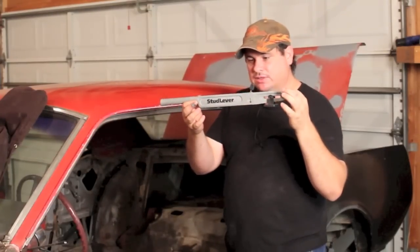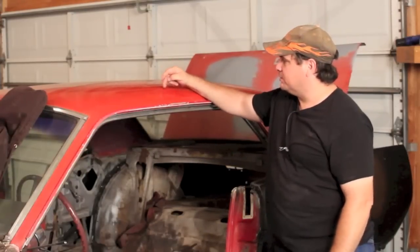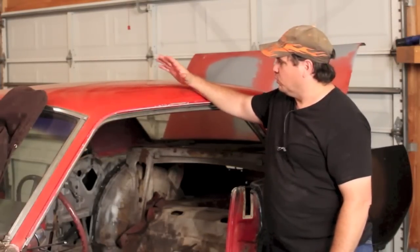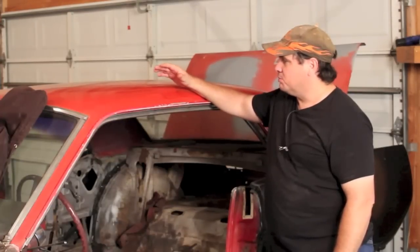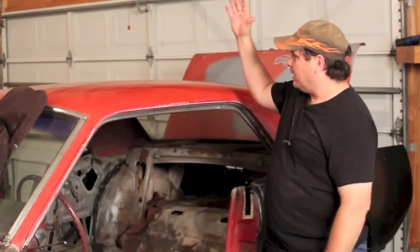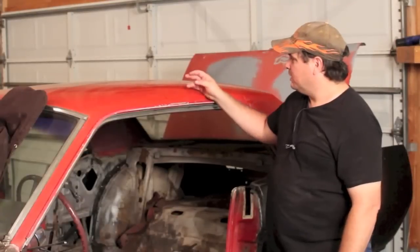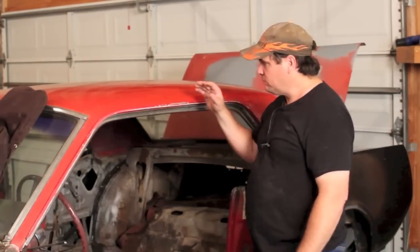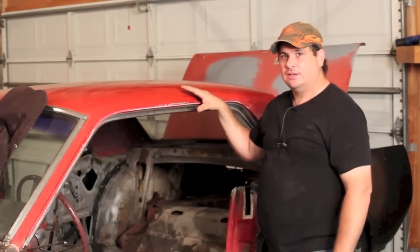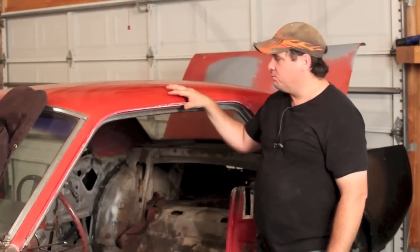First time to use this, we're going to test it out and tell you how it works. We've got this dent on this Mustang. Kind of a funny story about this dent - we had it parked outside of our house, and there was a big storm that came through and some trees came down and hit it right here. There are some other things that happened too, but this is one of the dents that resulted from that storm. So we're going to pull these dents. Before we go to pulling, you always want to take a look at your dent and not just go right down into the main source of it and start pulling.